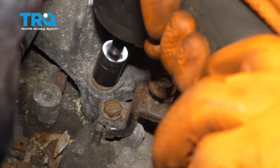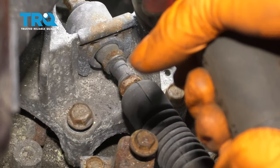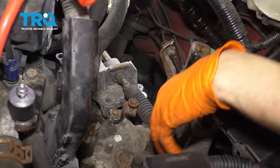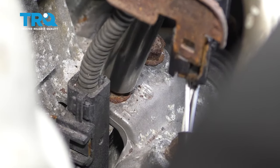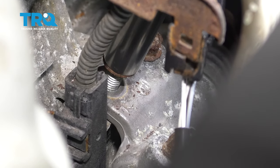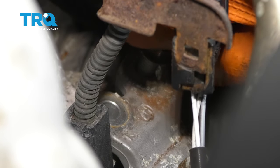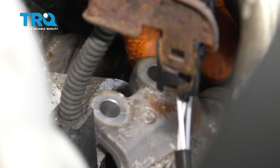I'm going to start with that 12-millimeter bolt in the back — it's kind of hard to reach and hard to see, and once you break it free you should be able to take it off by hand. It shouldn't be very tight. Now I'll remove this one and that one. As you can see, this whole bracket wants to come right up. Remove these bolts and set them aside safely — now this bracket is off the transmission. With a long extension, I'm going to squeeze in there and undo these two 12-millimeter bolts that hold on the slave cylinder. Remove the second one and take this right out. Now you can take the slave cylinder and just push it aside.